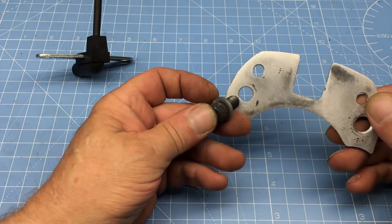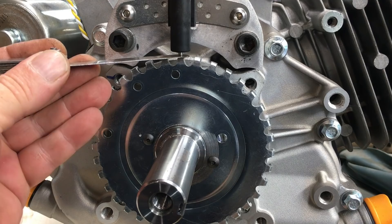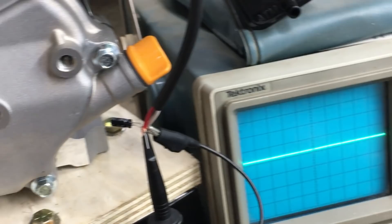Here's something interesting: the holes on the engine block we'll be using to mount the bracket are threaded for 3/8x16 fasteners. I'm not too surprised they use imperial threads, but most of the time when they do this it's fine thread. So fast forward a little bit, and the whole crank trigger system is mounted. The gap between the wheel and the sensor was set to 20 thousandths of an inch, or half a millimeter.